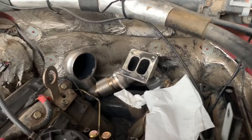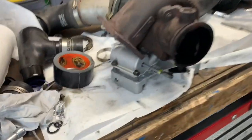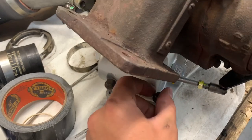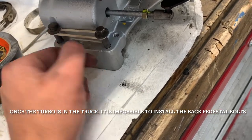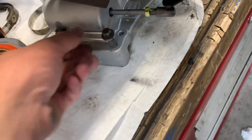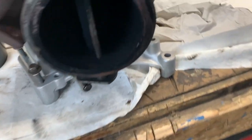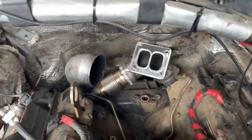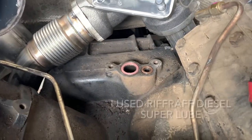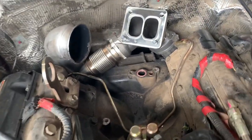Put your turbine inlet gasket on the collector — the studs hold it all nice and shiny. For the back bolts, when the collector is in position you're not able to slide them in, so use a rubber band to hold them up so they're not dragging around. Pull them up a little into the holes; the front ones are easy to get to. Get your new O-rings in, lube them up, and make sure the surface is clean — you don't want any old material left behind from the old O-rings.